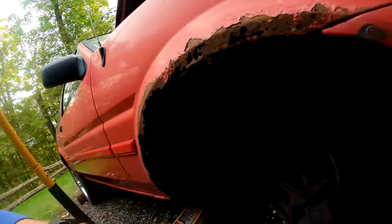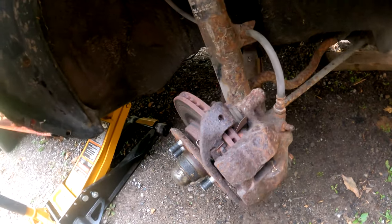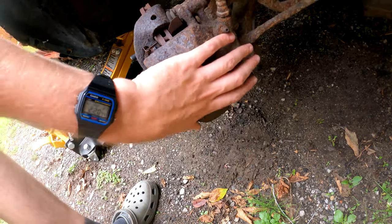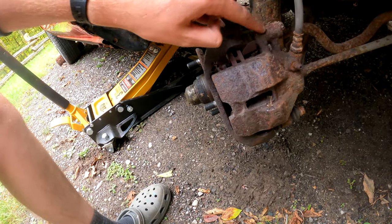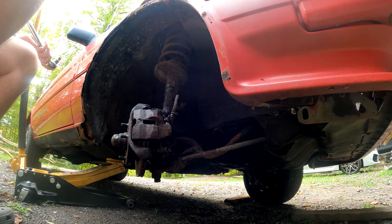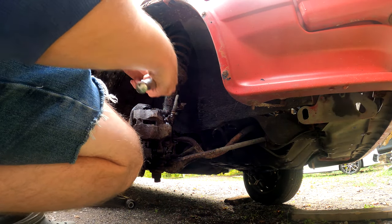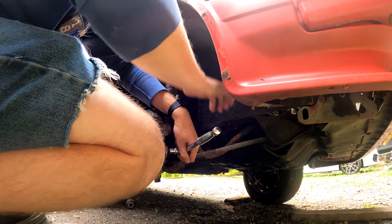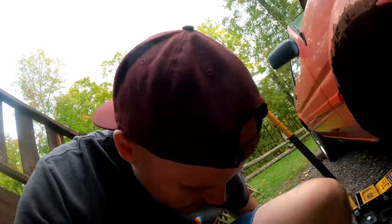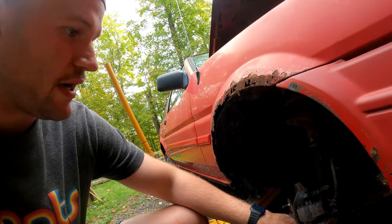Alright, we've got the wheel off here. As you can see, these brakes are super crusty. I knew that beforehand. I was having trouble getting some parts, so I didn't get to this sooner. Basically, we've got to take off — should be one bolt here that should let this caliper fold up and then slide off a pin that's in here, and then there'll be two bolts holding this bracket on. Let's see if it's as easy as that sounds. It's not going to be that easy because I've already done the other side and I know how seized they are.